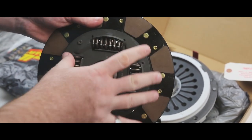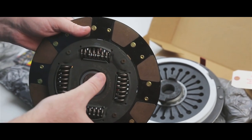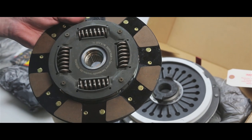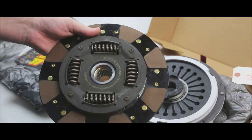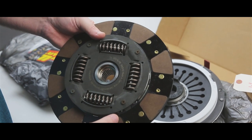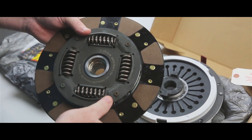Fiber Tough material is just as strong as Kevlar but less abrasive to the flywheel. As the flywheel makes contact with the clutch disc, Kevlar can really eat into the flywheel — that's where you get hot spots and end up having a flywheel go bad. Anytime you're changing your clutch, you really want to take a look at that flywheel and see if it needs to be replaced as well.